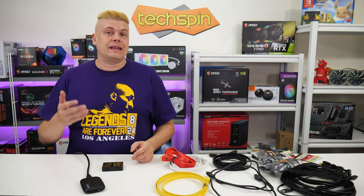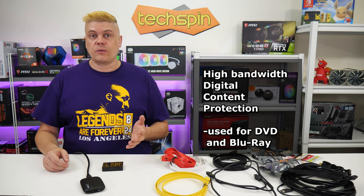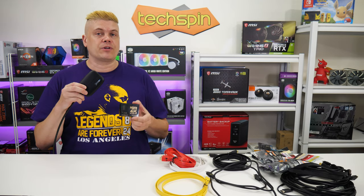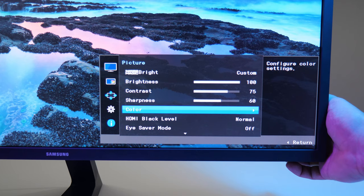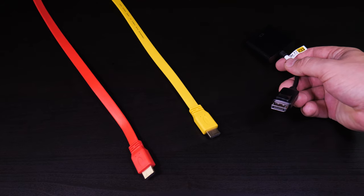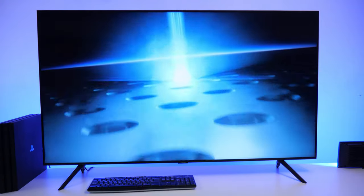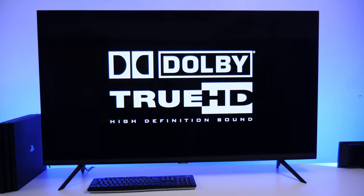A quick note: while you'll likely never encounter HDCP issues with video playback on a PC connected to a monitor with DisplayPort, we've had problems with HDMI rarely when going through a capture card or an adapter. For PC gaming, we prefer to use DisplayPort to hook up monitors, also getting around annoying HDMI black level mismatches on some monitors. DisplayPort cables just tend to work. However, for home theater HDMI is the winner — using DisplayPort to HDMI active adapters, we've had problems with Kodi passing through DTS and Dolby Audio.